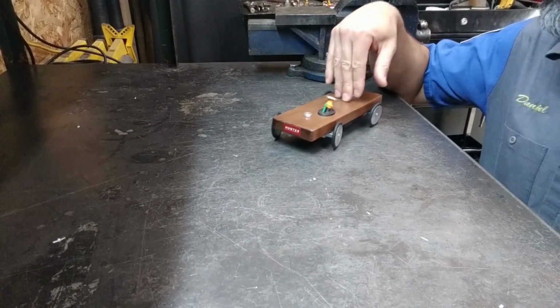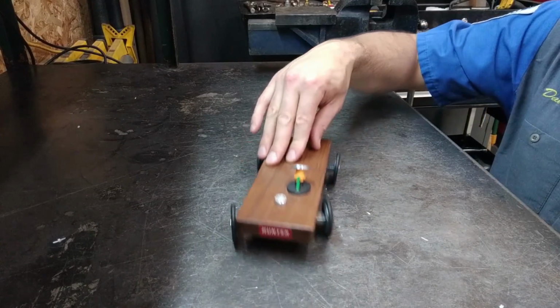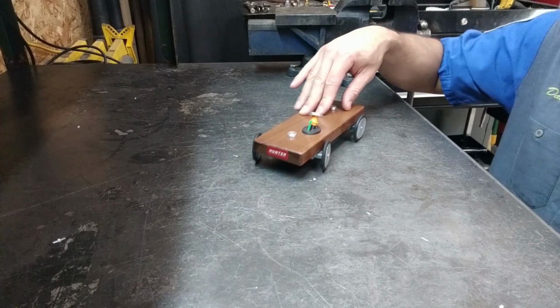In addition to performing the ABS three-phase function during a slip condition, combined with the stability control system, it's able to detect and correct understeer and oversteer conditions. The definition of understeer is the tendency of a vehicle to turn less sharply than intended. This pertains mostly to the front wheels. In an understeer situation, the driver is controlling the vehicle and intending the vehicle to turn a certain amount. Any less turning of the vehicle is considered understeer.